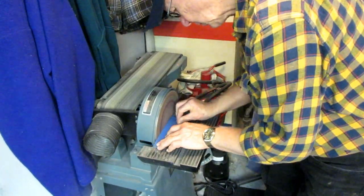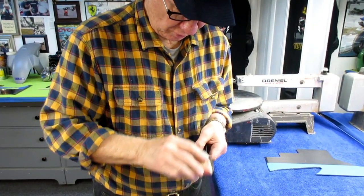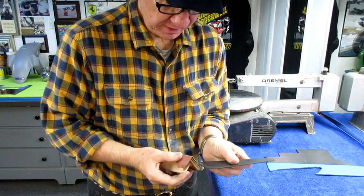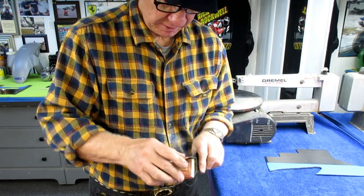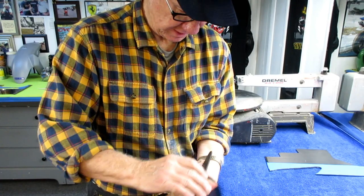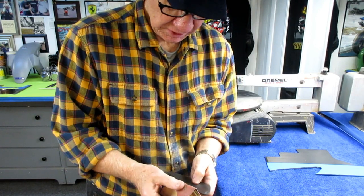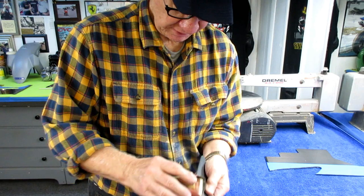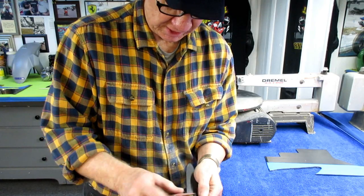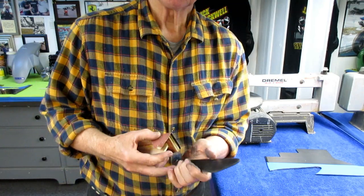Our next step is to get all the rough edges on this solid carbon fiber radiused - a nice radius around the edge so that it picks up the light. Unlike the part we made with carbon fiber weave, this will not have that problem because it'll be painted. You won't see the grain at the end; it'll be one totally smooth, totally shiny part when we're done with it. This will really give us some opportunities when it comes time to evil twin the bike - we can change the windshield, the side covers, and I've even thought about having a spare set of wheels someday.